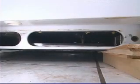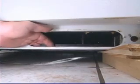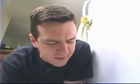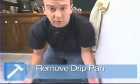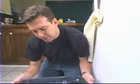Now don't be alarmed — it's going to be dusty under here no matter how good a housekeeper you are. But here you can see it. This plastic thing is the drip pan. Now that you've found the pan, pull it out very carefully. See, this one's got some old nasty water in it — we sure don't want that to get on the floor. Take it to the kitchen sink and wash it out with warm soapy water. Then fill it up again and hold it up to see if anything drips or leaks out of the bottom. If it does, you just need to buy a new pan.